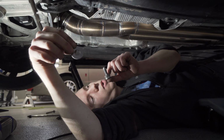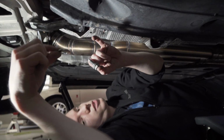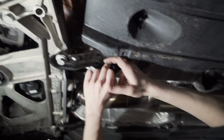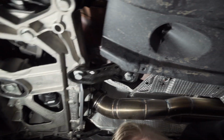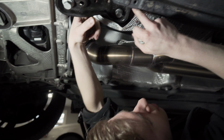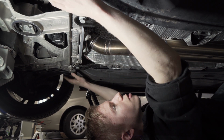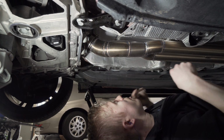So they include these washers for the very far back bolts on this black piece. You want to sandwich this washer in between the car and that black piece, which is easier said than done. I think I got it right there. So what that shim is doing is it's making up for the fact that we added in the spacing of that locking collar up front, so it's keeping everything correctly aligned still. And again, we're just pre-threading in so that everything is situated, and then we'll shimmy this. We'll try to get it aligned with where it was before we installed the IROS parts